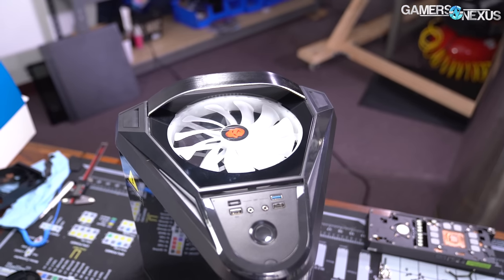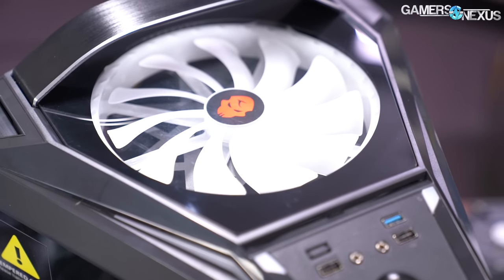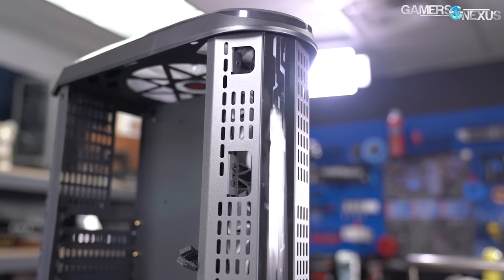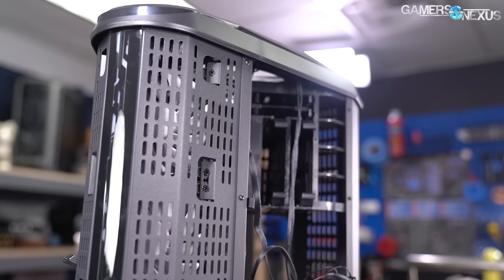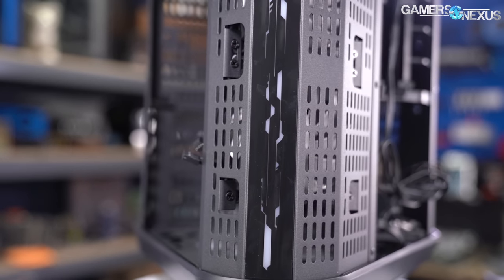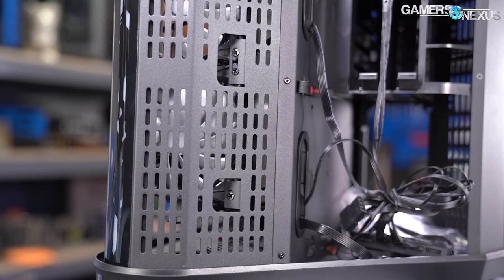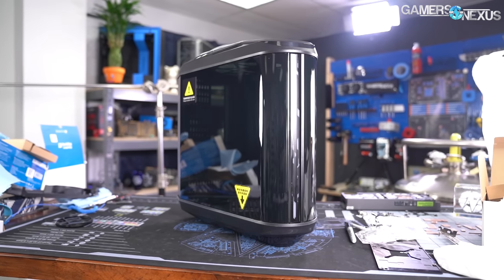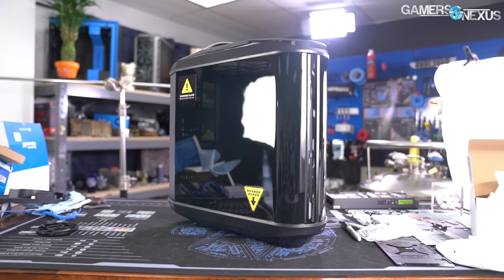The fans and shape of the case were primarily why we went through the trouble of buying this and bringing it all the way back home. Cooling is provided by four fans: two giant 200mm ones at the top and bottom, both intake, and two 120mm fans at the front corner — if you can call them intake — since there are no intake vents whatsoever at the front. The plastic side panels completely cover the vent holes cut into the metal chassis. Our best theory is that the fans are supposed to pull air in around the edges from further back, where cool air is supplied in theory by the 200mm fans. We don't need to wait until the full section to tell you this is a bad design.